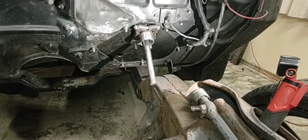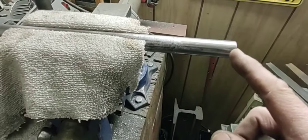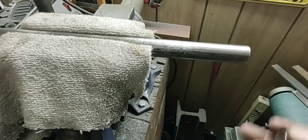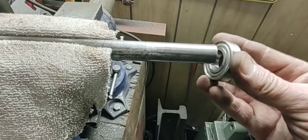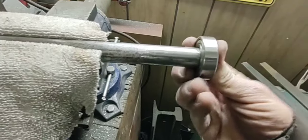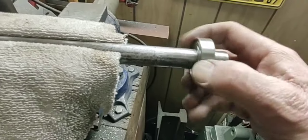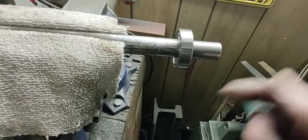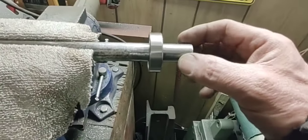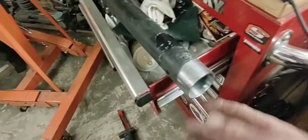Here's another little trick: the bearing didn't want to go on here, but I knew it was the same size — pretty tight tolerances. I put a little bit of oil on there because it ain't gonna slide on without oil, it'll just stick. Look at that — it's nice and tight. So I got a cut for the right length; we're gonna go seven-eighths in and then make that double-D and test it with my Chinese knuckle. I still got to fit this bearing into that column.